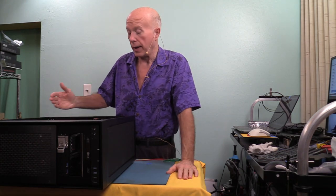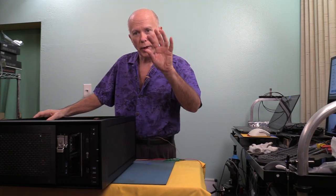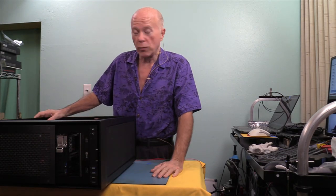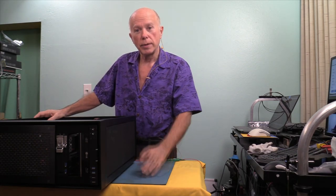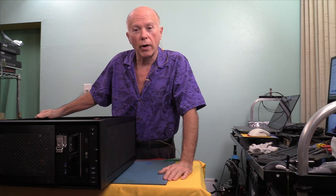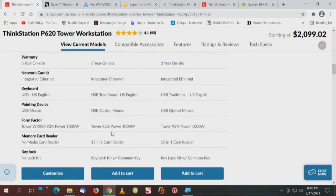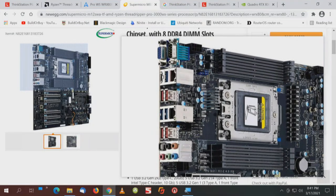Based on two of those cards — if I'm using a Quadro I can live with a 1,000 watt supply. But if I'm putting in something like an RTX 3090, that might be a little slim. I'd want to increase the wattage. And it's not just about the wattage, but about the connectors. As we look at the ASUS motherboard, we've got more power taps than we've ever needed before. Going from the ASUS board to the Gigabyte board, you add another power tap depending on whose Thunderbolt card — Thunderbolt 4 has an extra power tap.